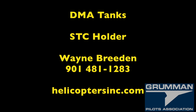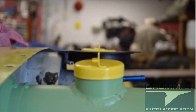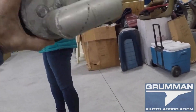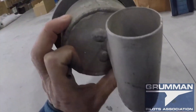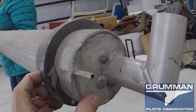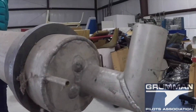Today's version has two gas caps, so an aux tank has its own cap as well as the main tank. We're used to seeing that on all the ones like Ken Blackman did and Gene did before — you have two gas caps. But on the early models you only had one gas cap, and it was able to fill the aux tank because it had a little ductwork that went over and attached to a piece of rubber tubing where there was a fitting welded on the original bulkhead of the main tank.